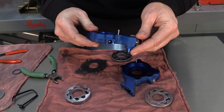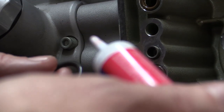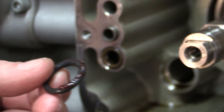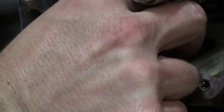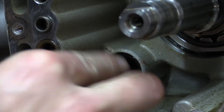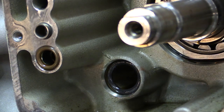We will start with the inner housing onto the bike. The first step in the process of installing the new oil pump is the O-ring. We're going to add some lubricant to the O-ring. The O-ring is supplied within the kit. Add some assembly lube to the O-ring and place it within the case, making sure it seats all the way. You do not want to put the O-ring on the housing and then place the housing onto the motorcycle, as this may bind the O-ring or not seat the O-ring at all.